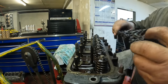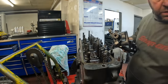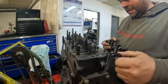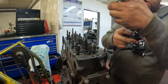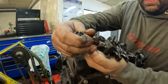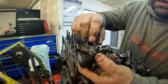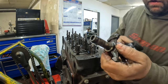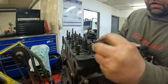And then basically all this will come apart. So you've got the rocker. If I move this camera back, you'll have a rocker. When it's worn, it gets a bit stuck. Then the rocker post, which lines up in that hole there, if I can turn it round. So just there. That's what basically positions everything, and the stud holes go through all of it. But now I can remove all of this and the springs to get this ready for reconditioning.